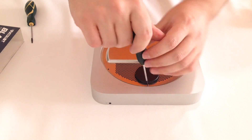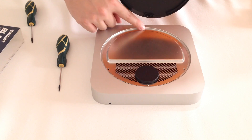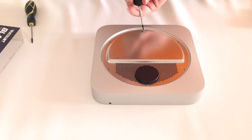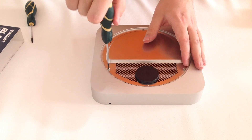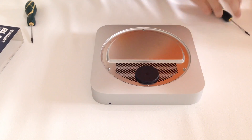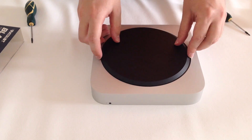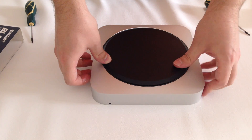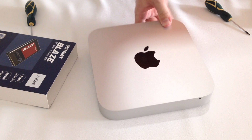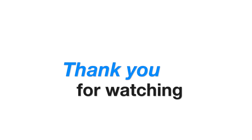Put one of the short screws to hold it in place. If you don't remember where the longer screws go, here is a little tip: you can use the plastic cover to see where to put the longer screws. One goes at the bottom and the other two go to the upper left and upper right side. Put back the two remaining screws and make sure all the screws are tightened. Finally, it's time to put back the plastic cover. Align it so that the three longer screws go inside the three sockets of the plastic cover, gently push it down and it should snap back into place. That's it! You have just upgraded your Mac Mini with an SSD drive. I hope you find this tutorial useful and thank you for watching.